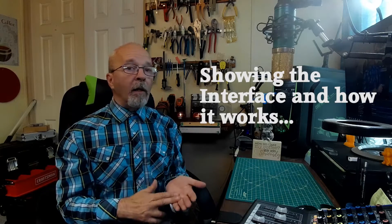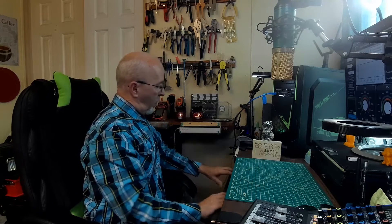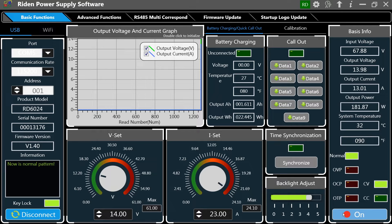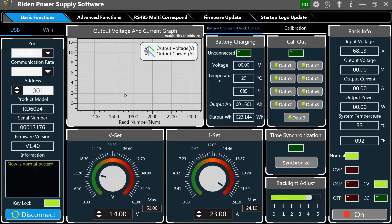You can see way better on screen what's going on. The bars — in the manual it does say it pulls eight amps, and eight amps in a 12-volt system in your car is going to pull around 96 watts. Without further ado, let's get right to it. It's spiking to 13 amps — that's three amps over.